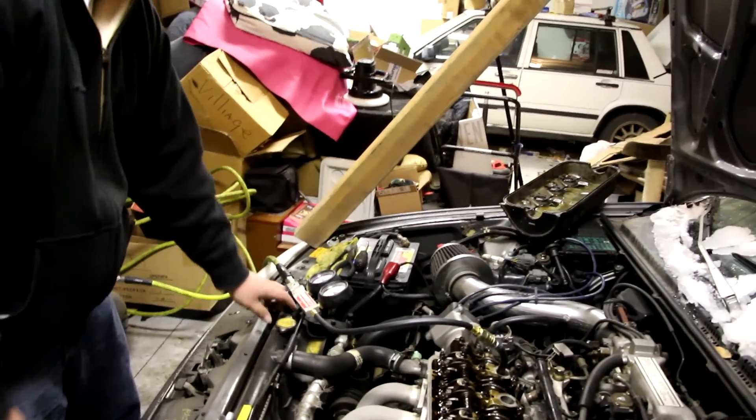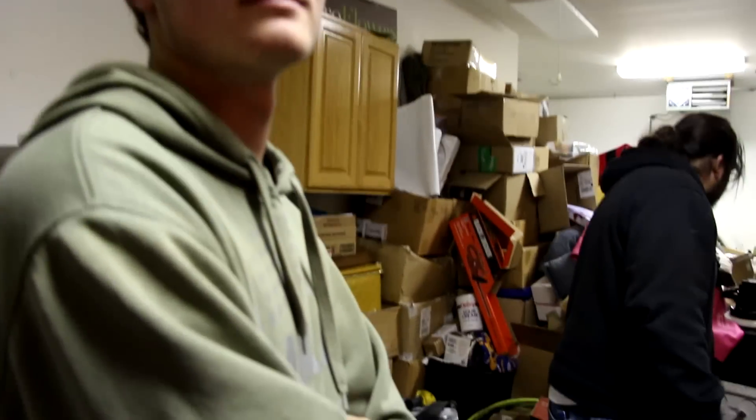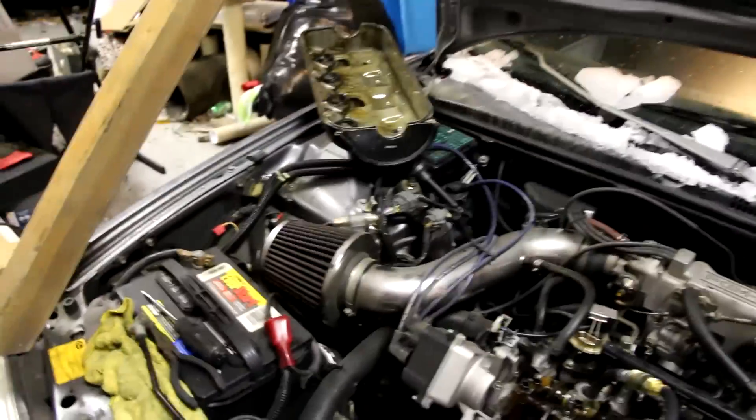So a leak down tester — you pump air into your cylinder and listen for where the air is coming out. You take out your oil dipstick and leave the tube open. Take the radiator cap off — you're supposed to drain the coolant but we have coolant in there, so if it's the head gasket there's going to be a geyser. Send Jake to the back of the car to listen at the exhaust. The intake cone filter is another place to listen. Wherever the air comes from is your problem area: intake means intake valve, exhaust means exhaust valve, radiator cap means bad head gasket, dipstick tube means bad rings.